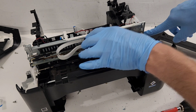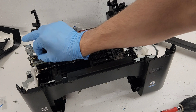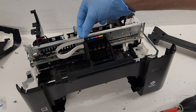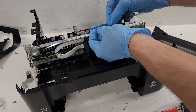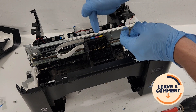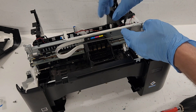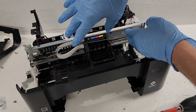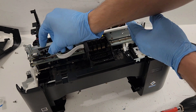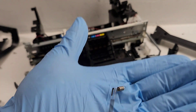This is our control panel, and this is the timing strip that runs in the back of the carrier unit. If you're having vertical lines on your prints, it's usually because this is dirty somewhere along the line - you'll see an ink spot or something on here that's preventing the sensor from reading it correctly. Or if it's ripped or out of the sensor, the carrier will just move with a loud bang noise and then give you an error. The printer cannot work if this is out.